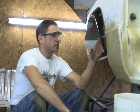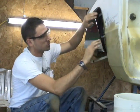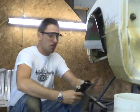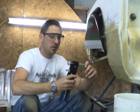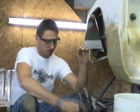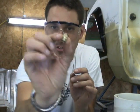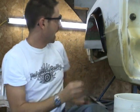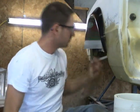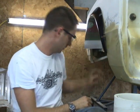I started installing my fender flares here. They're not permanently installed yet — I've drilled all the holes and put the nutserts in the holes, but I haven't clamped the nutserts down. If you aren't familiar with the nutsert tool, it looks like a regular rivet gun, but you push in these little nutserts. They're really handy when you can't get to the back side — you just put a nutsert in the hole, crimp it down, and you've got a permanent fixture to attach your hardware to.